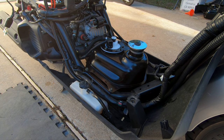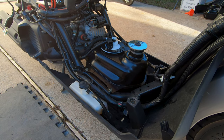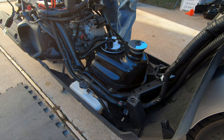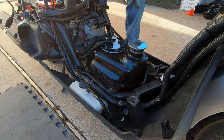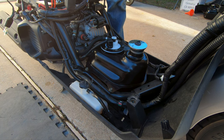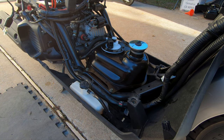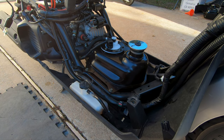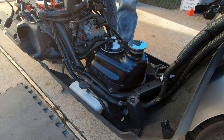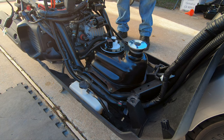Not happy, but it's running. That was probably the carburetor cleaner that was in the injector — so it fired for a moment. Let's give it another hit. It's going to need more battery. You could hear the fuel pump spinning as I was kicking, but that was it. I think I'm going to need more battery — I'll hook up my jumper over here and see what we get.